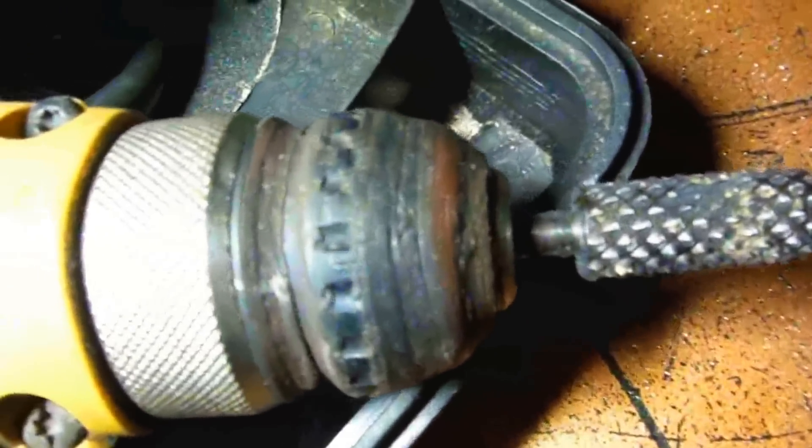I've got the Suzuki Samurai's air cleaner sitting directly on this Toyota carburetor, and you can see it gives you plenty of clearance — you wouldn't even have to dimple the bottom of the carburetor because all the control linkages now have plenty of clearance. It's a total air and watertight seal. So if you want to use a snorkel setup, this actually solves the air cleaner issue where you'd have to dimple the bottom. You got to open up that rubber grommet just a little bit with the drill attachment, takes about 10 minutes, and now you've got something watertight for a snorkel. This Toyota carburetor is actually the best carburetor going for a Suzuki Samurai replacement — better for hills, gas mileage, and low-end torque.